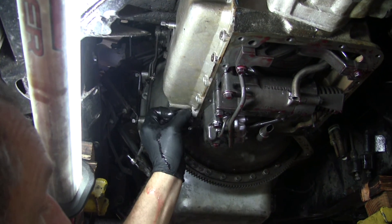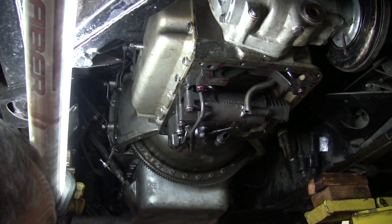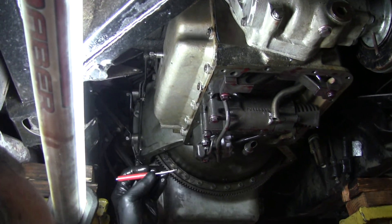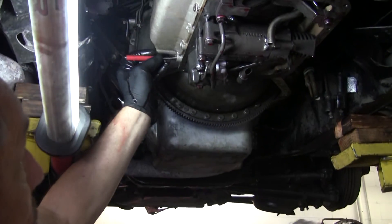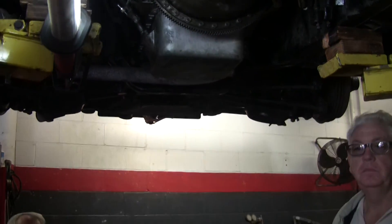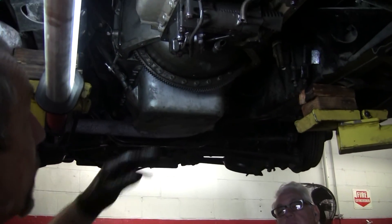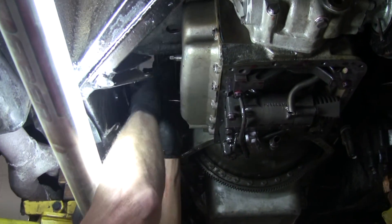My problem is when that takes something apart and it's got bolts left over. So this can only go in that far. This is a great way to check what size bolts you need — just stick a screwdriver or something smaller, take your finger up to where it goes, and then you know not to put a bolt longer than that in. That's the only one you really got to worry about on this; the rest don't have an issue.